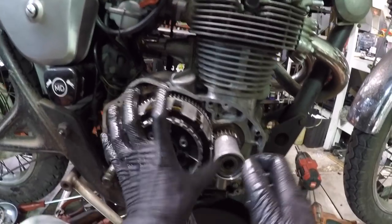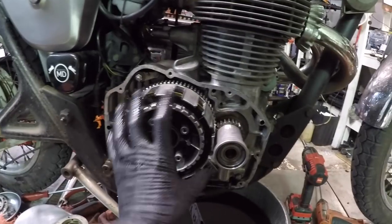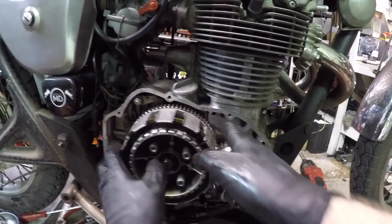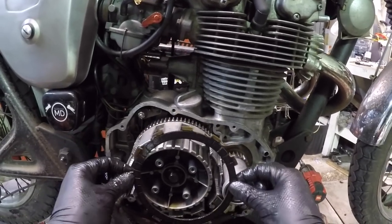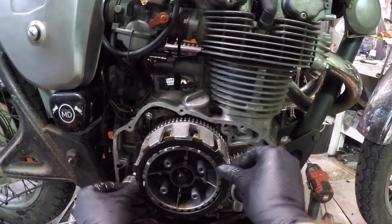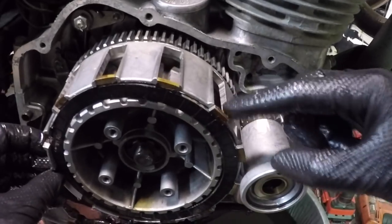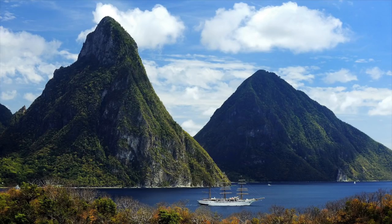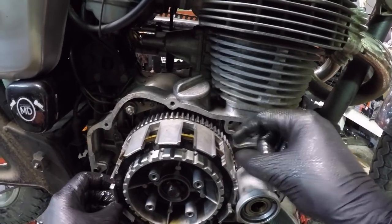Because when you drop that clutch out, it sends a shock through your whole clutch system, and it locks like it should, and it grips and gets your transmission going, but it takes these plates and it goes bam, bam, bam, and over time, that small amount of play wears into here, okay? And that can cause little grooves, almost like little mountains or hills or valleys in all the separate plates.